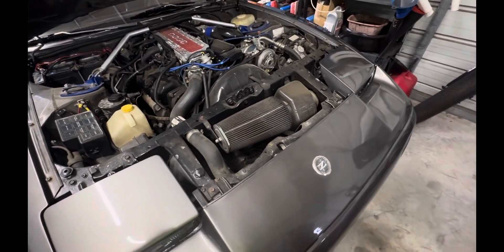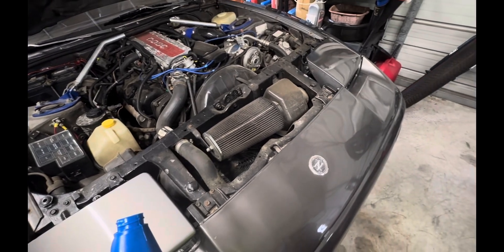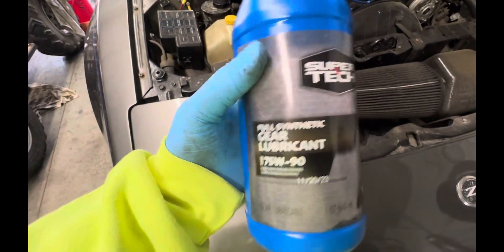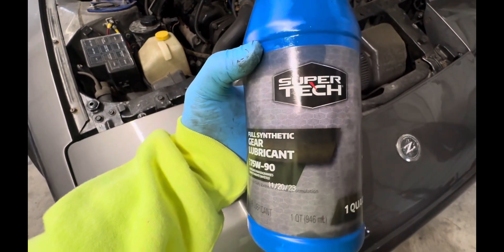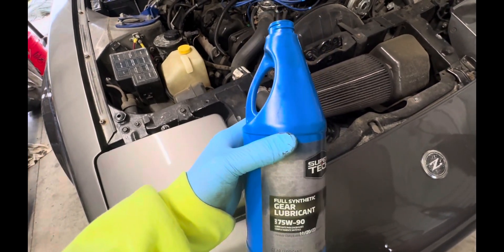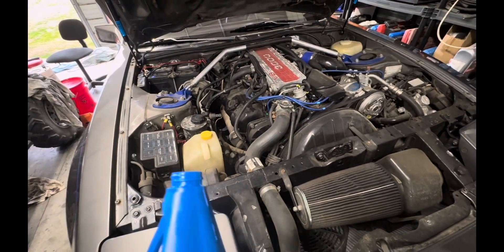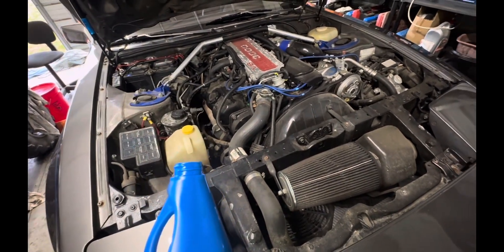For now I'm just hoping I got lucky on that one and didn't have to replace it. My next step was going to be finding a speedometer cable in case that was worn, but so far just taking the pinion gear out, cleaning it, and putting it back in worked. This is the gear oil I used — Super Tech 75W90 from Walmart, cheapest place I could find it, about eight or ten dollars. I used about a quart and a quarter to fill the transmission back up. These cars also take the same gear oil in the rear end, so I changed that too.